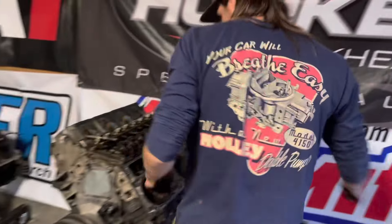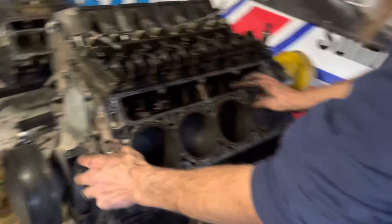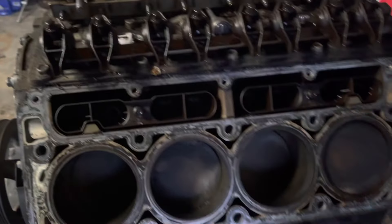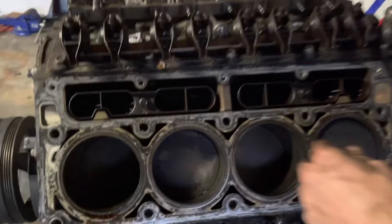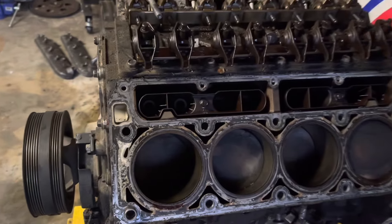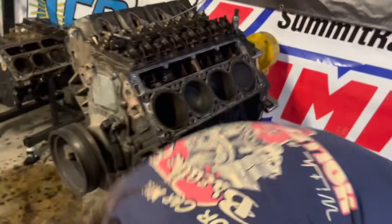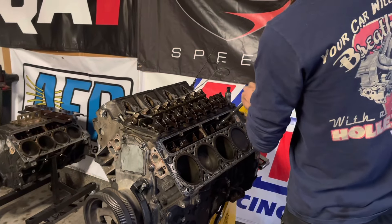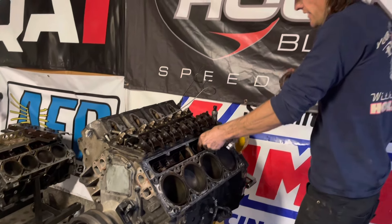The thing that is most likely wrong with this engine is a lifter failure. That's what happens with all these engines, and the Trailblazers are not really desirable and very hard to work on — imagine doing all this in the car. Now we're going to pull these lifters out and see if we can find one. Hopefully you'll see what they look like — hopefully one has collapsed, and that is why this thing was in the yard.